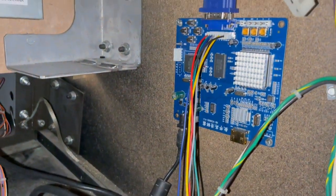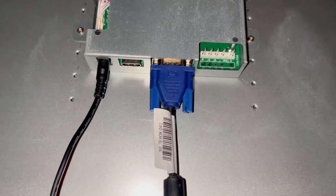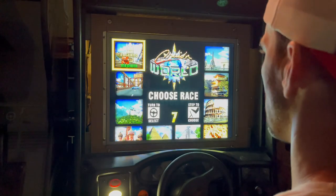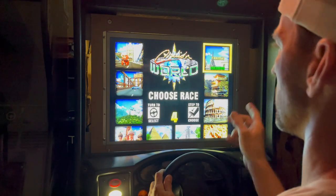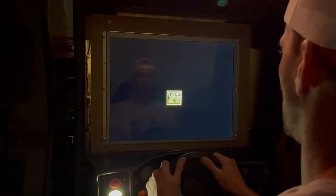Then came what I thought would be the easy part — just hooking up the wires. I was going to reuse the same converter board that converted the CGA signal into a VGA or HDMI signal, plug in the VGA cable, and away you go. Unfortunately it wasn't quite what I expected. The image didn't fit inside the LCD panel correctly — left and right were fine and the top was visible, but the bottom was just cut off. To make troubleshooting easier, I removed the entire LCD assembly to try different input devices.